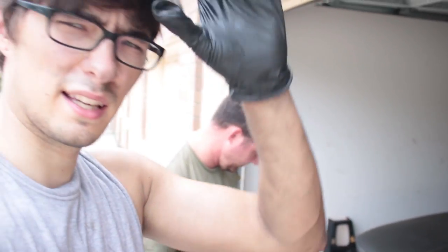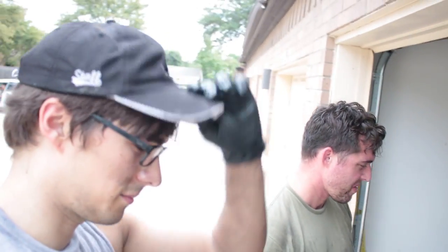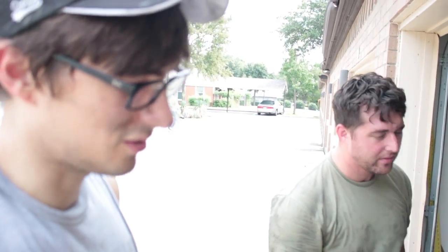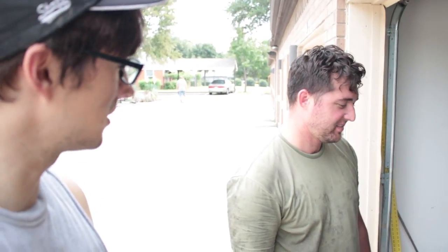Oh gosh. It looks like brakes are pretty much done. They're on there. We went with the E36 TI brakes for the calipers in the rear as opposed to the M3 just for safety's concern because the shim was a little sketchy. Yeah, the shim was a little sketchy. We bled them out, changed all the lines, and I think we're good. I think a 5-lug swap was successful. What else do we have to do? I just gotta tighten some bolts.